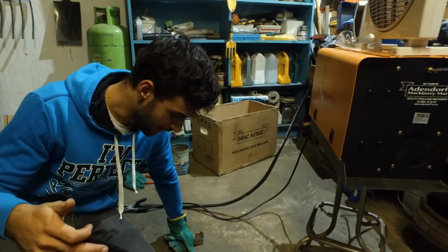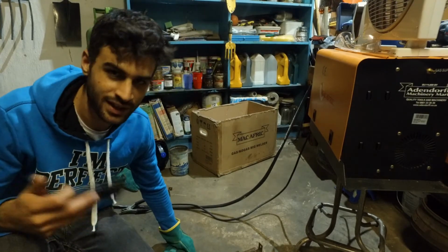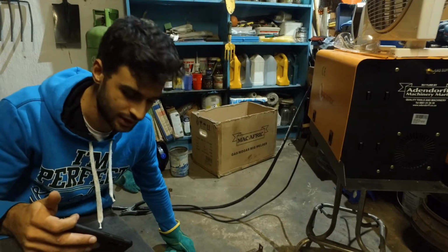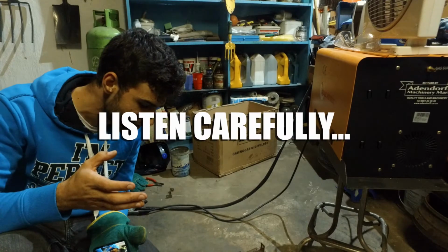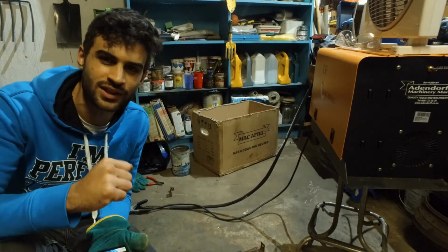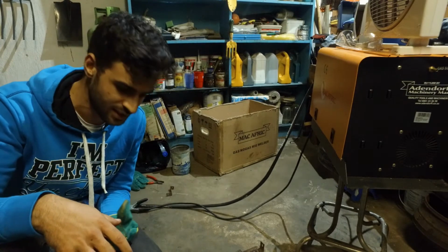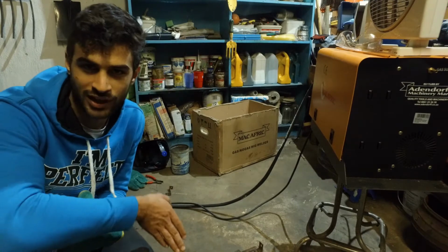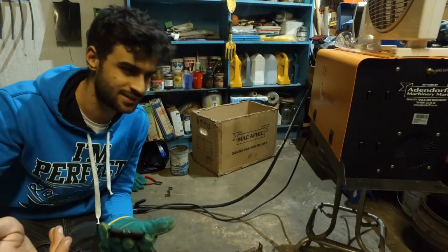So I'm gonna put you guys on a time lapse. Let's get this thing tacked up. I'll tack it up with you guys here, and then we'll put it on a time lapse, and I'll weld it up on the other side. We don't need to be 100% accurate, and you know why? Because a degree off isn't gonna throw us off. This thing isn't 7 kilometers long. 1 degree isn't gonna make much of a difference. I'm just gonna line them up next to one another, get the angle right on the one, get it on the other one, tack it in place, and then turn it around and weld it up. That's the plan.